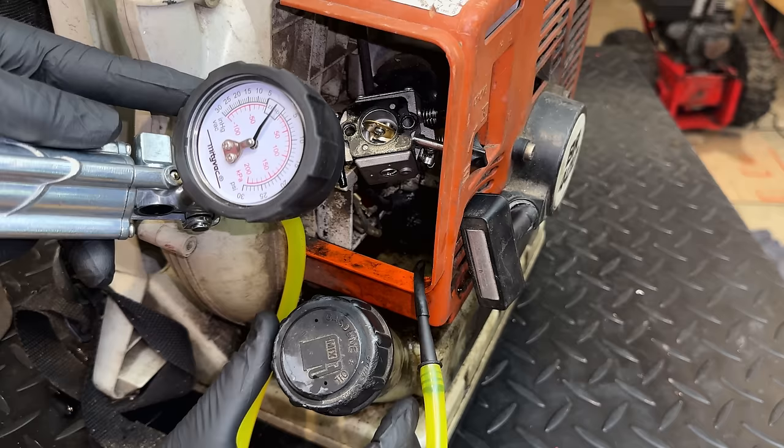So I double checked the thickness just to make sure. The gasket I have cut up already is pretty close to 31 thousandths of an inch thick, and the gasket material that I have is closer to 30 thousandths. So it's actually a thousandth thinner than what I already have. So yeah, there's no point in making a gasket. I think this one will be fine.